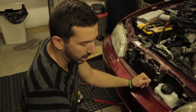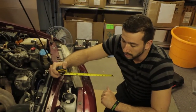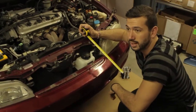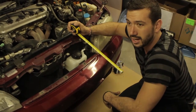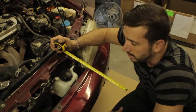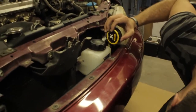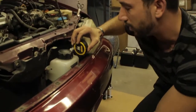Once you've got your tank mounted, you can start working on your cell positioning. We've gone ahead and mounted our reservoir. One of the main things you would have done prior to securing it down is make sure you have a nice 12-inch drop from the bottom of the tank to where your cell is going to be mounted — that's for a single cell kit. Dual cell kits, you'd like to try to get 14 to 16 inches, but that's a tough figure to hit. If you're going to be substantially less, in the range of 8 or 9 inches, go ahead and check out the link below on pumps to make sure your system stays circulating. We measured and it's right at 12 inches, so we know we did a good job mounting our tank.